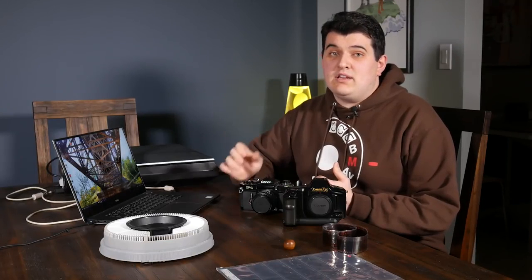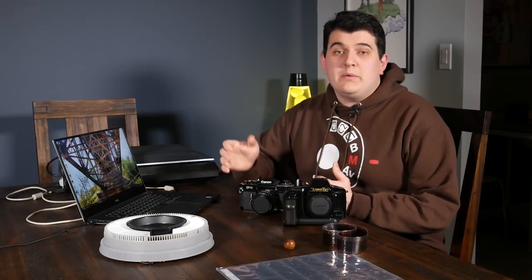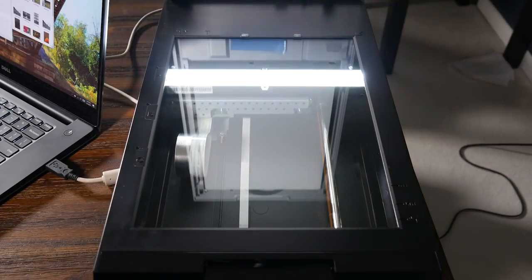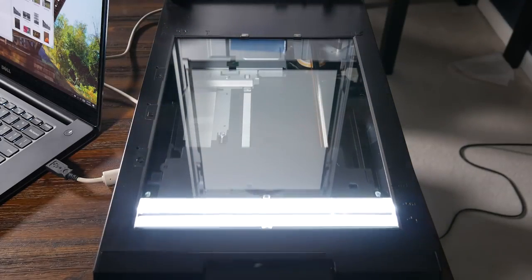This is a flatbed scanner like any ordinary document scanner, and when scanning a photograph or a piece of paper, the scanner uses 2 rows of LEDs to illuminate whatever it's scanning, and between them lies a single row of really tiny light sensors that build an image as the scanning head dutifully travels below the glass.